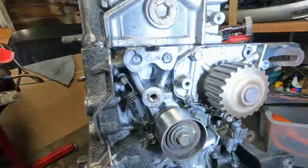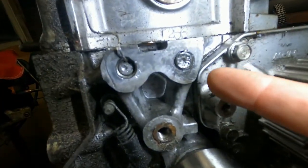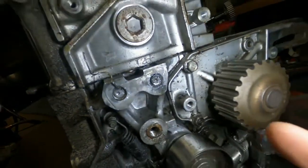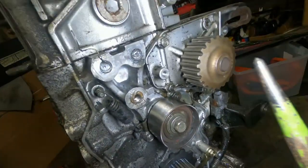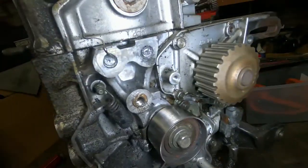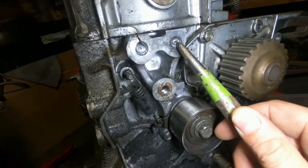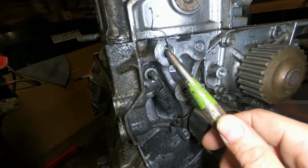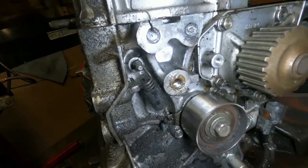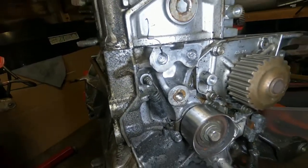Check this out — I've been drilling at this for a minute and slowly working it, and it actually started moving and is coming out by itself. I've been tapping on it with a really pointy chisel, just slowly working it and tapping it around, and it's been spinning out. So this one's coming out. I've got to work on the second one now — get it out, clean it all up, then re-helicoil them or tap them and lock tight them.